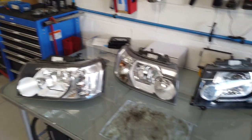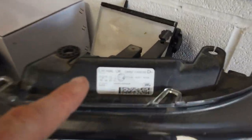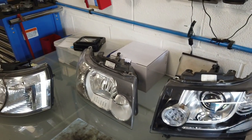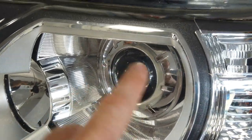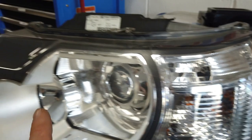Freelander 2 headlights come in many different colors and shapes and sizes. One thing to note is if you look on the top and it says 'HAL', that means it's a halogen. What we're showing here should be the same for most halogen types. If you've got HID bulbs it's a bit trickier. The halogen ones can look like the type with a little umbrella, but the ones with a glass eye are also halogen if the label says halogen. Xenon ones also have that label, so the label is your best guide.